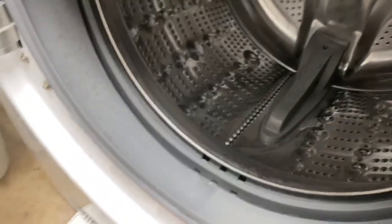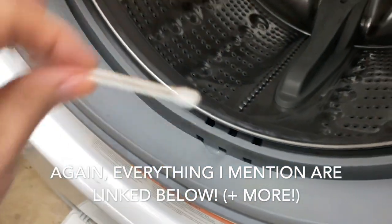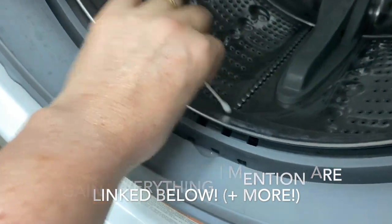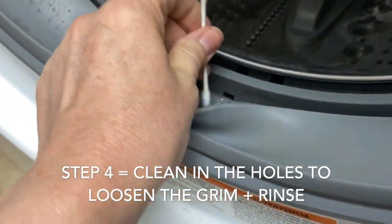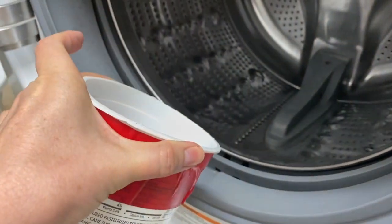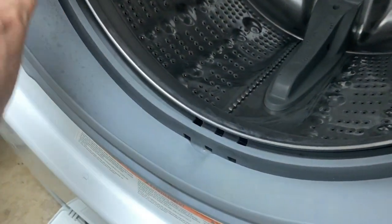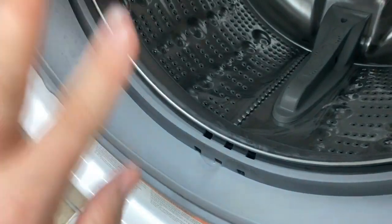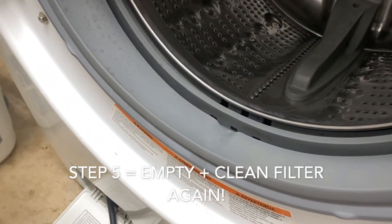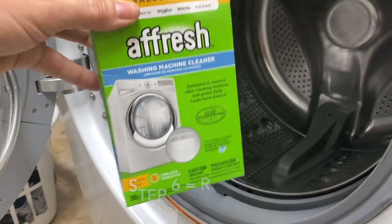Here is my golden awesome rule, because this is where all the grime just sits — inside the holes in the gasket. I took a small tool — you can even use a Q-tip — and I poked it into these holes and kind of worked it around inside. Then I dumped clean water in there, let it sit, twirled it around, and tried to rinse it. Then I emptied the filter again, because that's where it's all going. Then I went ahead and did another cycle, and just repeated that.